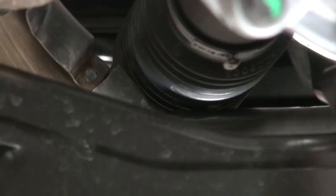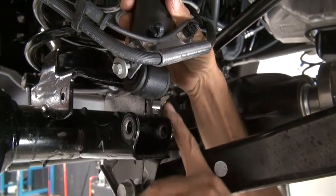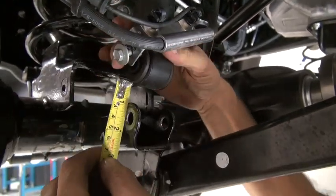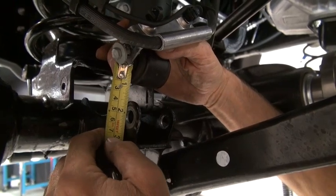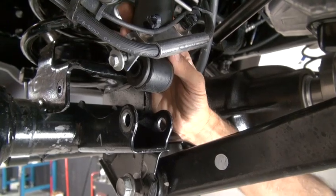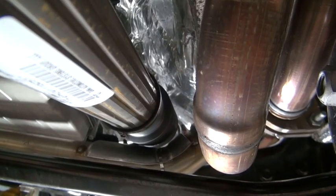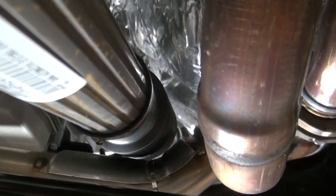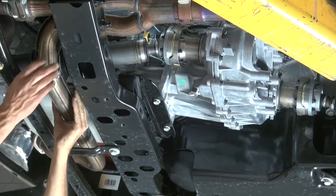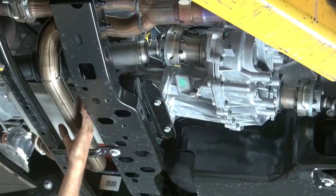We're just barely off it right there. With the axle dropped down, we can see where the shock is fully extended and where the axle is fully drooped until that driveline made contact. We've only dropped the axle two and a quarter inches before running out of clearance. So if we put any type of lift on this at all, we're going to exceed the limit that the shock provides and that front driveline is going to make contact with that exhaust pipe. The exhaust system is moved further forward than on older models, so we need to bring that crossover pipe closer to the cross member to gain enough clearance to lift the vehicle.